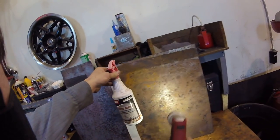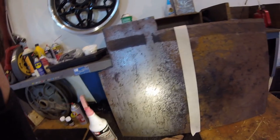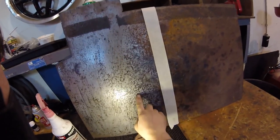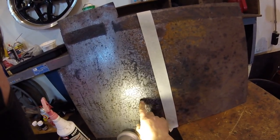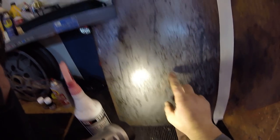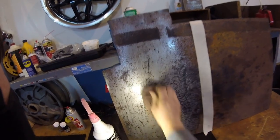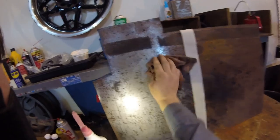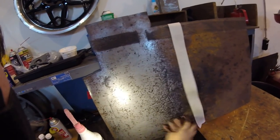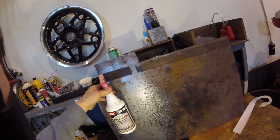You can see this side here is pretty much how it looks untreated — just how we picked it up. And on this side, the rags are a little acid-y, but look at this — I can just wipe it and it comes right to almost bare metal with no rust at all. That was all I did — just some Rust Mort. You can really see how it just dissolves all the loose rust, and any rust that's into the metal it converts to ferric phosphate, which is all this blackness you see. But you can see the clean metal — almost like a brand new sheet — just from a little wipe after spraying. I think it's actually still working as I'm sitting here talking about it.